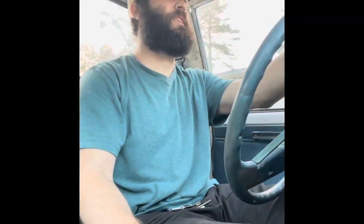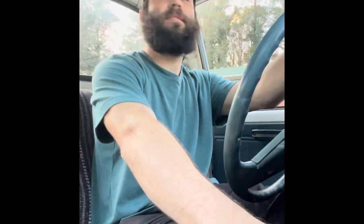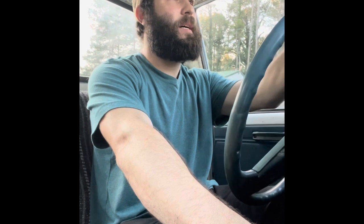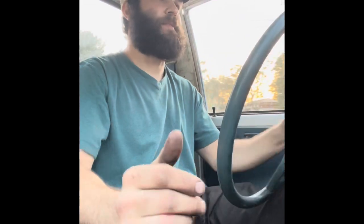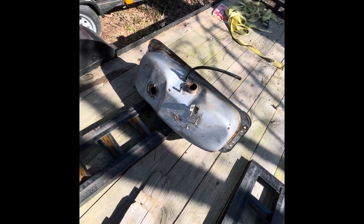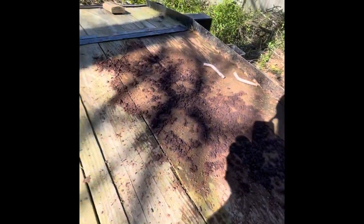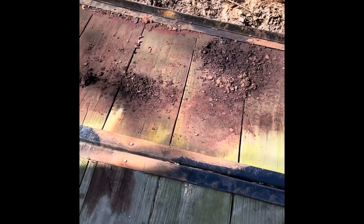This thing's running — it runs great. I did a ghetto boat tank in the bed to see if my intermittent issue was a fuel pickup in the rusty tank. Clearly it was. I definitely should have done this first — I talked about it a lot, never did it. Here we are, I finally did it. This is why the truck kept having issues. Drop the gas tank and just do it.